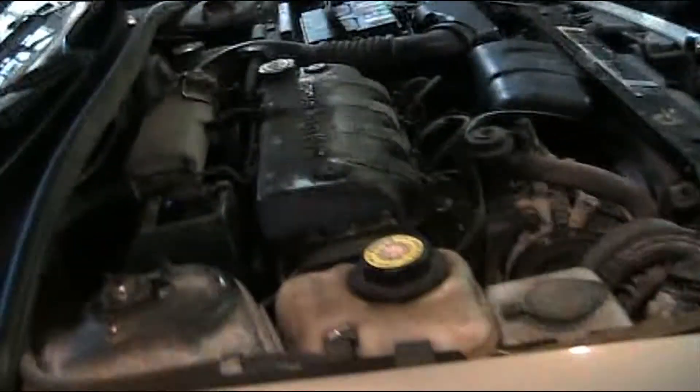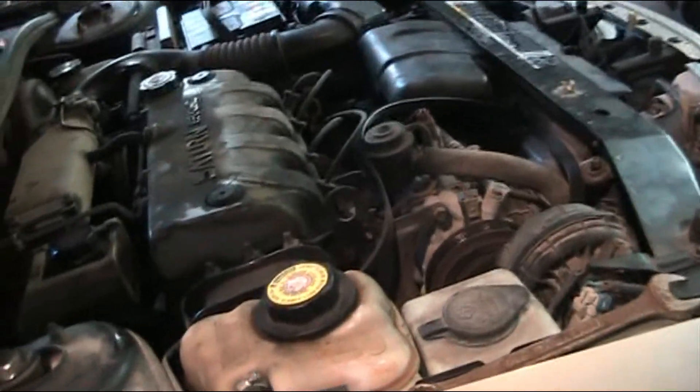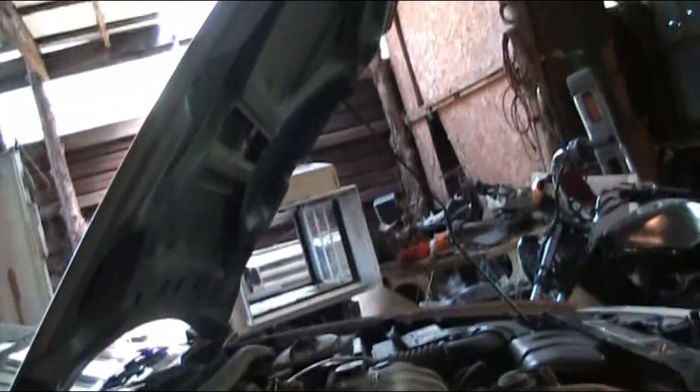I don't have a video of putting it back together, but this is what it takes — you've got to be able to access right here. Either way it had to come out here, so you've got to jack it up, put it on a jack stand, take the dust cover off, and then this inner cowl — whatever they're calling this cover or mud flap — and you can get up in there with a wrench and a socket. Alright guys, thanks for watching. Please subscribe and check out my other videos. Sorry this wasn't a great one, but it shows you what you've got to do.